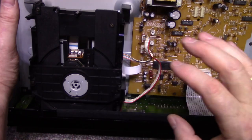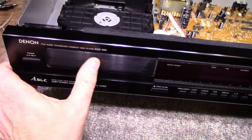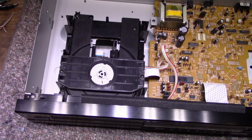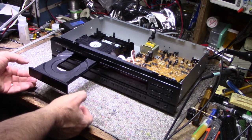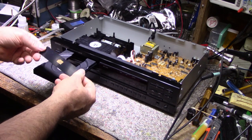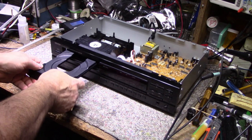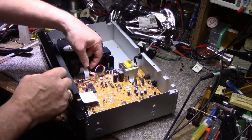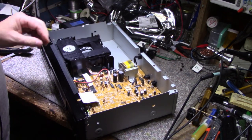So we're going to need to remove the CD drive mechanism. I know I have to take the door off. I don't know if I have to take the front panel off. Let me get the tray in the out position and then we'll start working on it. So I got the tray out. We have to take this front door off — you just pull on the bottom, pull it forward towards you, and then lift at the same time and it slides up. To put it back on, from the top slide it down and click it on. Let's take this off for now, push the tray in, and now I can disconnect these cables and remove four screws.